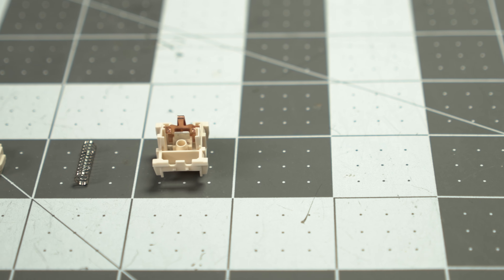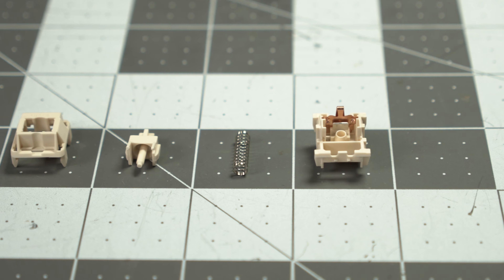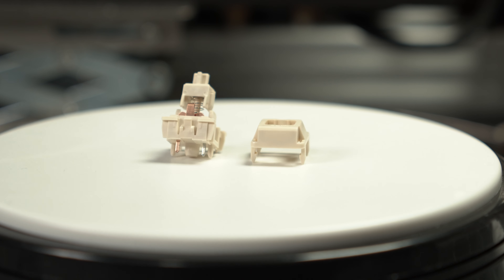Does this work? Well, yes and no. If you push the switch down slowly, you'll feel this odd friction, almost like if you're wearing leather pants and sat on a leather chair. If you type quickly or relatively normally, you won't really feel it at all. This leathery feeling is particularly bad if you're hitting the keycap at an angle, even for normal presses. So how do you fix this? Well, the same way you should treat every other linear switch — with lube. When lubed up with your preference of choice, this really doesn't become a problem anymore.